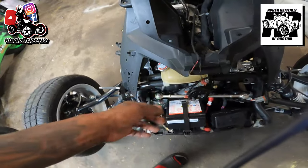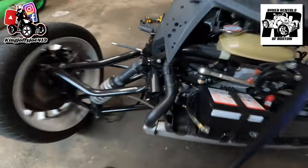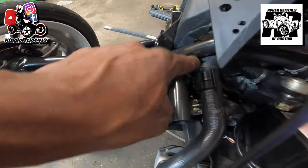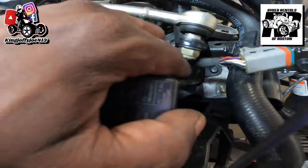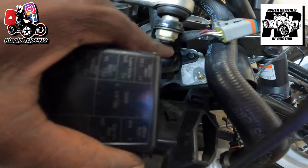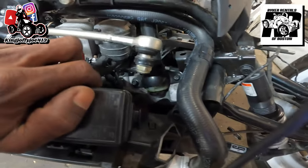Simple things we noticed: someone had spliced in there for some reason, which is weird. Ground wires were drilled into the frame. Look how close this is in there — I don't know if this is bent because something hit bad at one point. The bushing here — the steering bushing — that's bad. That bushing is bad, so we're going to be replacing that bushing.